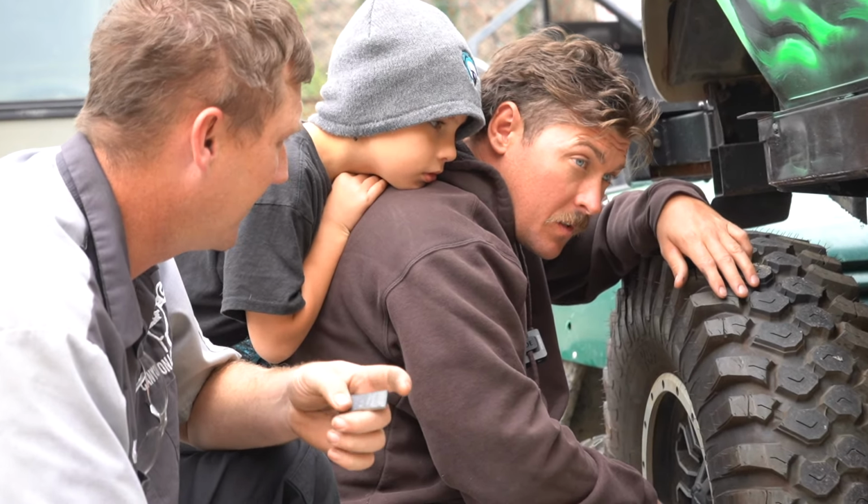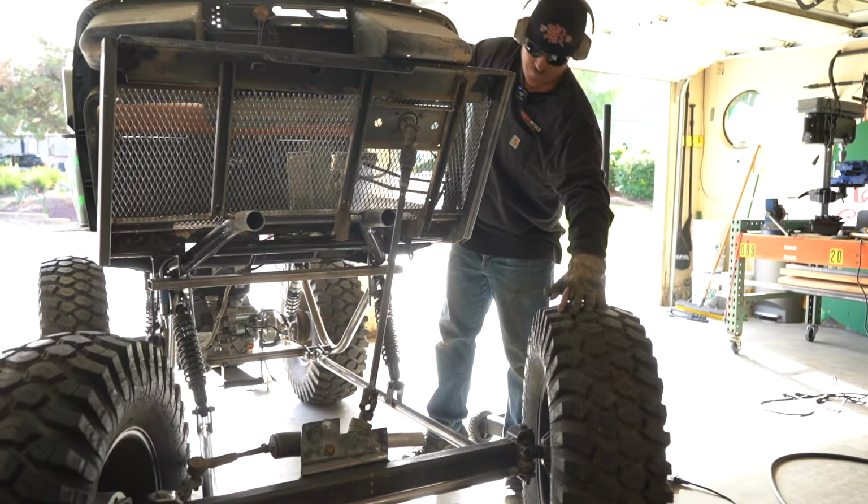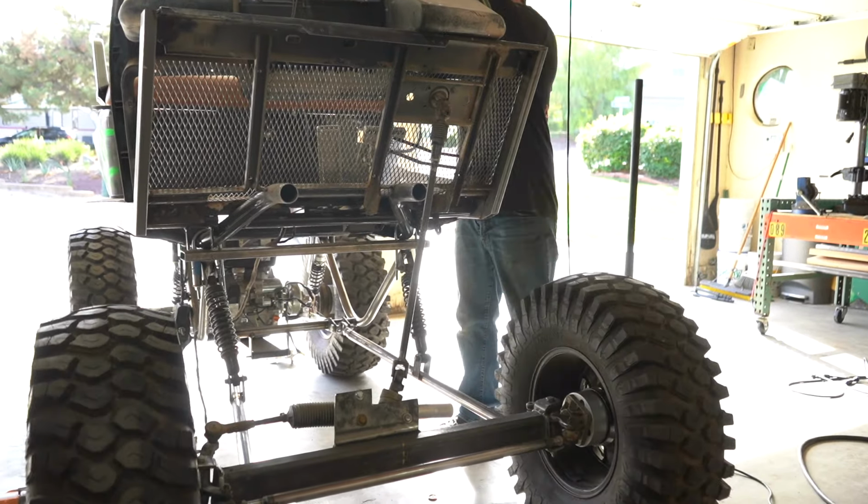I think for the job's sake and keeping it within budget for him, take care of the rubbing first. So change the front links, get a better angle on that, and ensure the steering is adequate. Do some bracing because the pitman arm looks a little screwy on that as well, so that might need to be adjusted. Let's see what we can find to have a better system, get it running, and make it look all pretty.